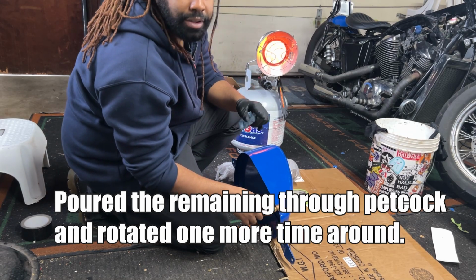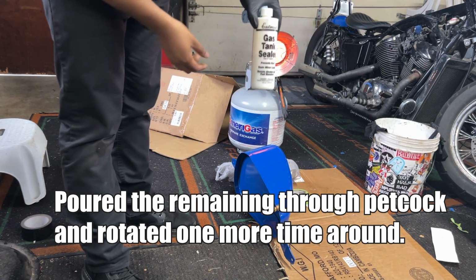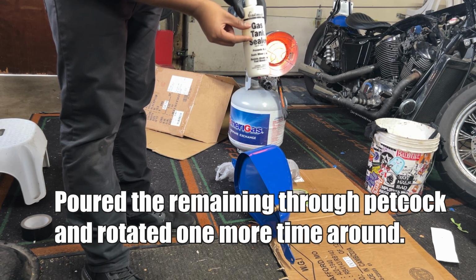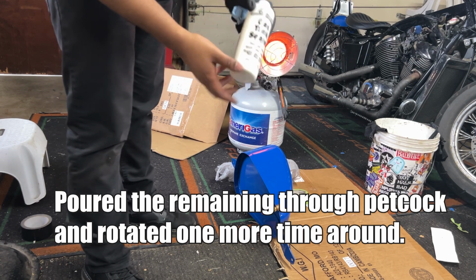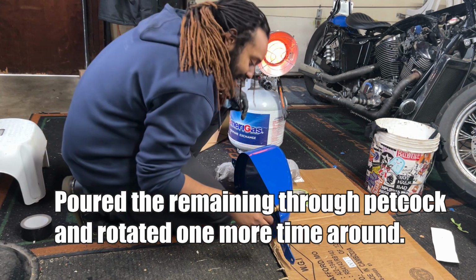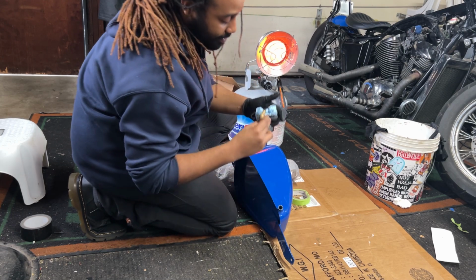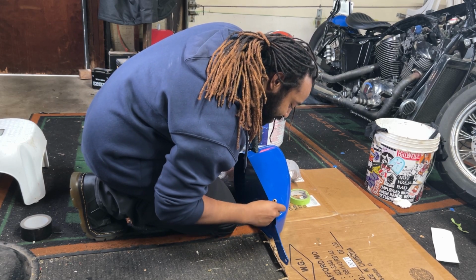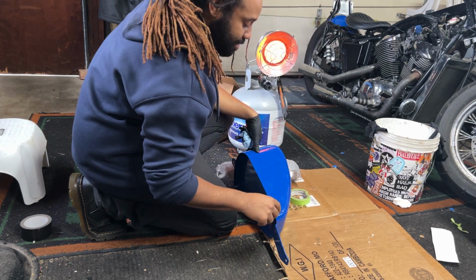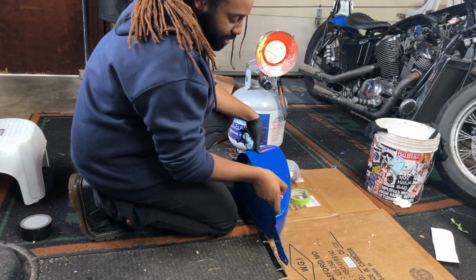Let me go ahead and show you guys this real quick. I already did this part. Poured it back. We probably used about that much, maybe about 1.5, almost 2 pints of the sealer for my tank. Right now what I'm doing is threading it in and out, cleaning it off. I'll take it home and show some love so I can get that all cleaned up. It seems to still have a nice good thread.